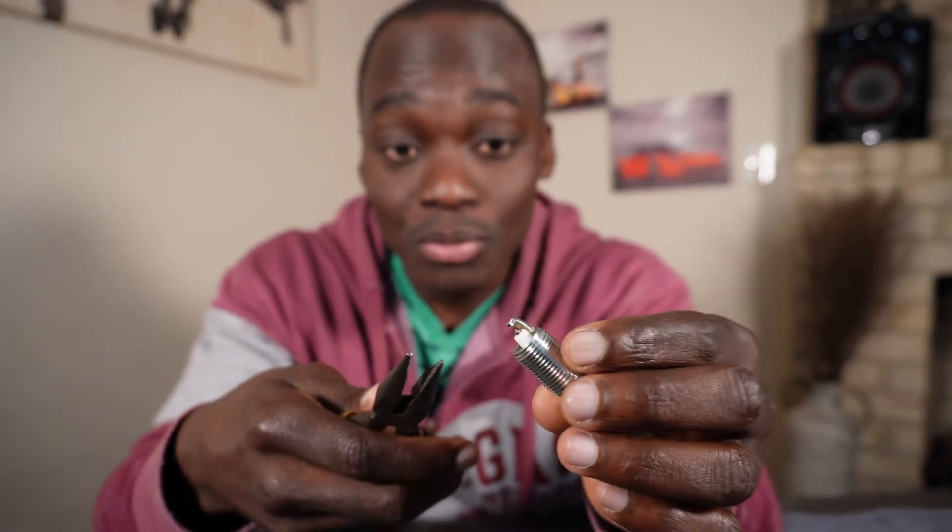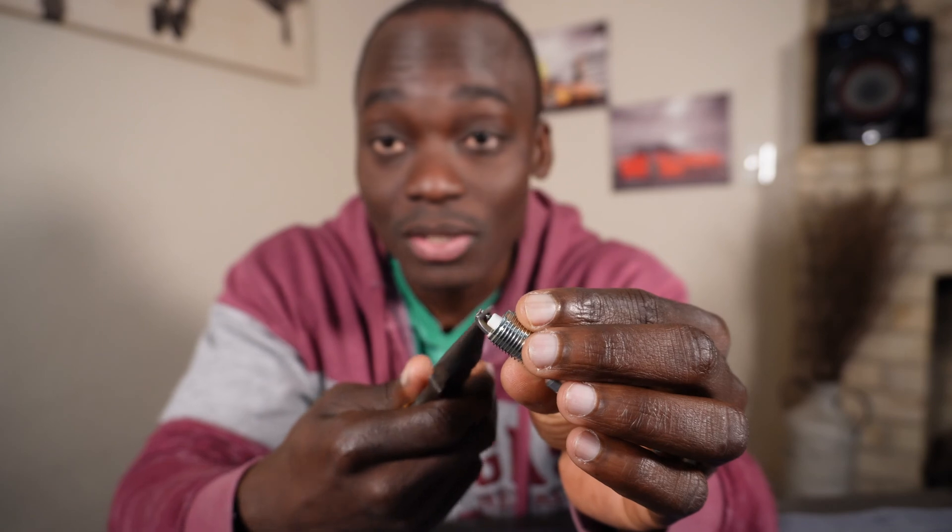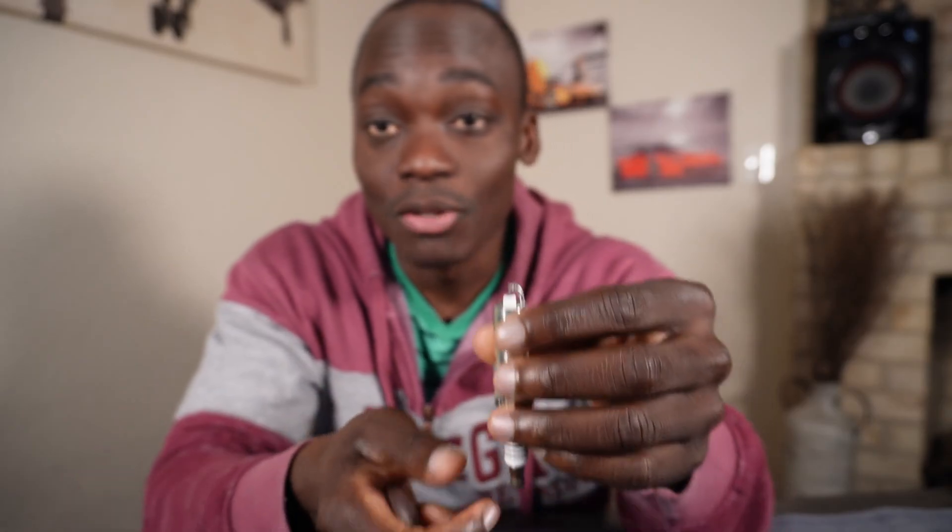That's the reason why it is not recommended to use this tool, but there is a way around this. If you don't have a better tool, you can use needle nose pliers to pry the side electrode away from the center electrode if you want to open the gap, or you can just tap on it a little bit to close the gap. You still need to use the manufacturer's recommended specifications to gap these Iridium spark plugs.